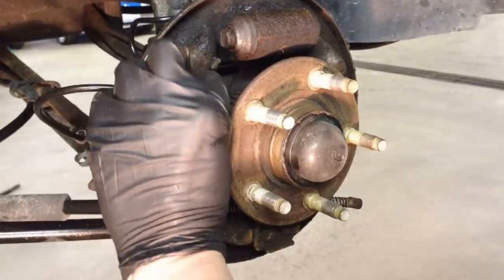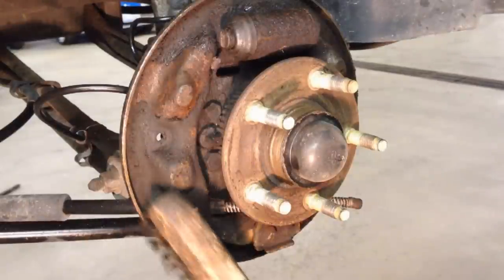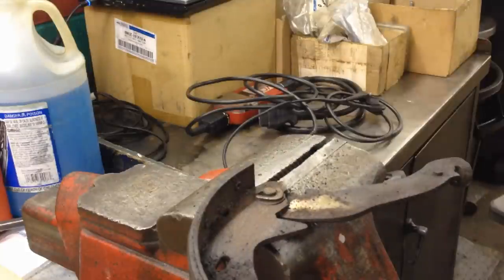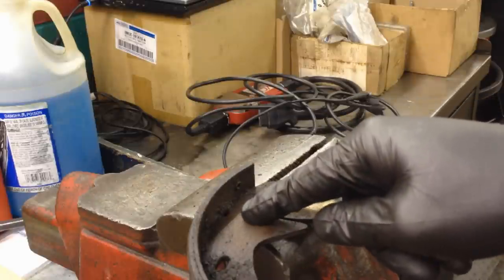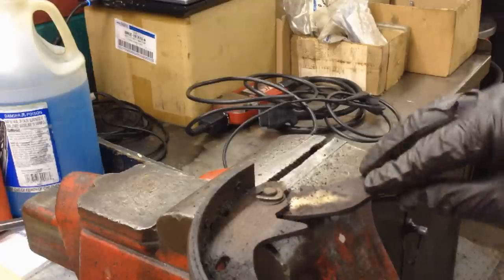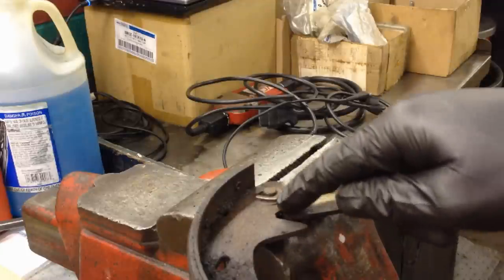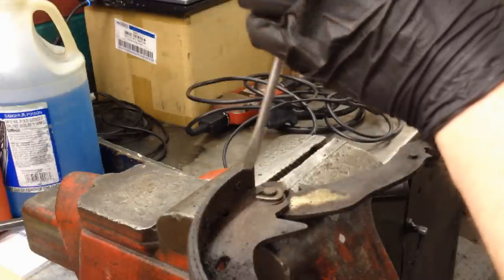You can see the paint on the actual backing plate is peeling off, and that's from the brake fluid — so that's another sign in case you're wondering if that's grease or brake fluid. It's brake fluid — it's peeling the paint right off the housing. I'll do this off-car to show you better how to release the parking brake actuator from the actual shoe. The cable hooks in here, and this rod stays on the car and gets transferred to the new shoes. Flip over the shoe and access the horseshoe clip — there's a spring wave washer underneath it.